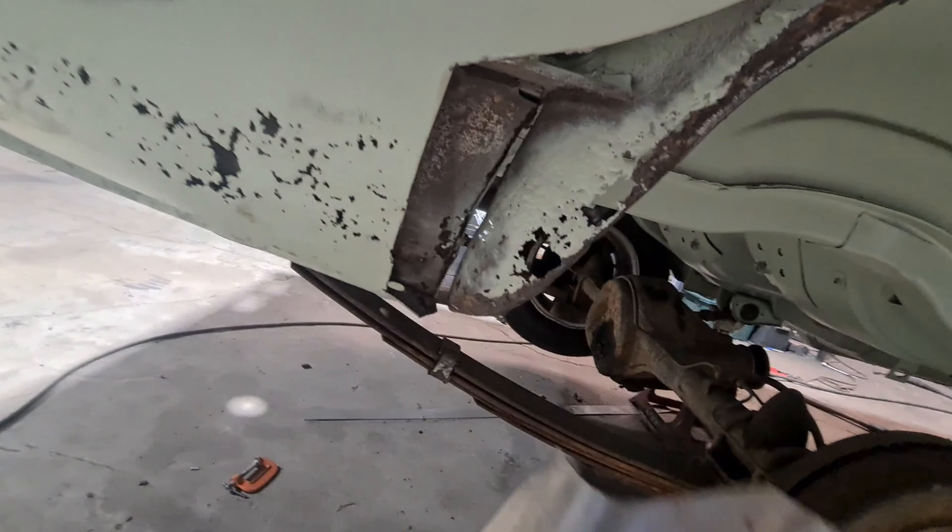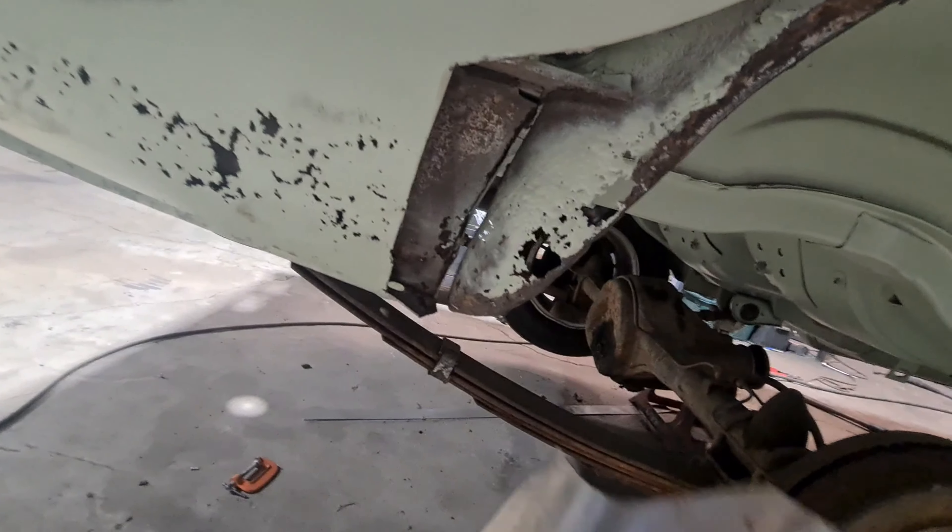I'm hoping to do this lower section in two maybe three pieces, and probably make this other part in one — just a single fold. To push this radius into it, it's not a real sharp fold, it's pretty round. I draw it on and use a round upper die with a soft lower wheel, just running that through a fair few times. I left it long enough to do both pieces out of this because it's easier to manipulate if you've got something to hang on to. You're probably wondering why I go to the effort of replicating this original shape — it's because there's actually a bracket there that does something, a void and a pocket, probably a muffler shield or something like that. That's going to stay original.